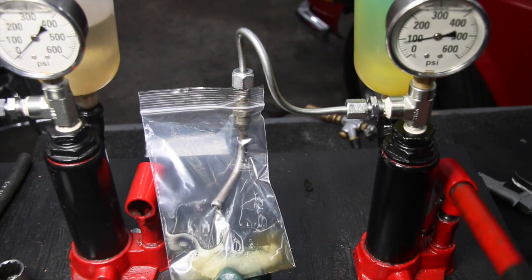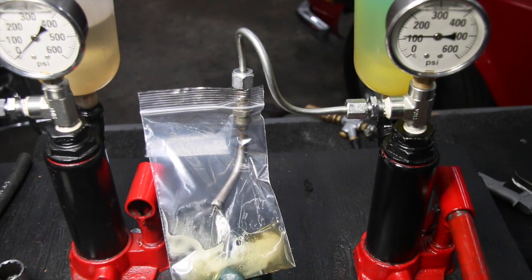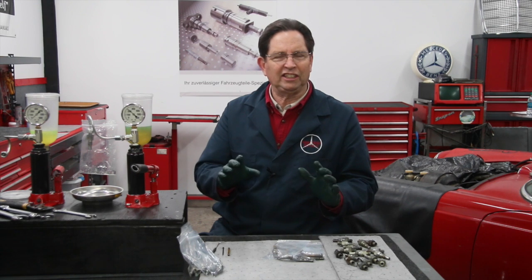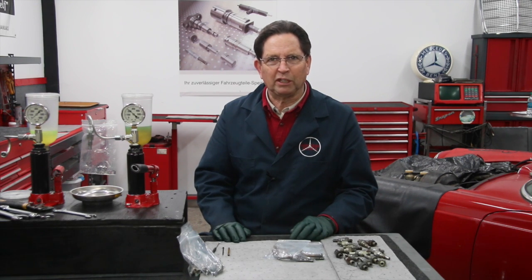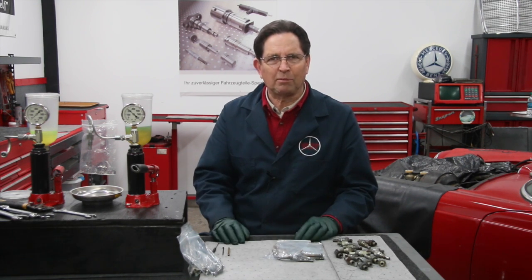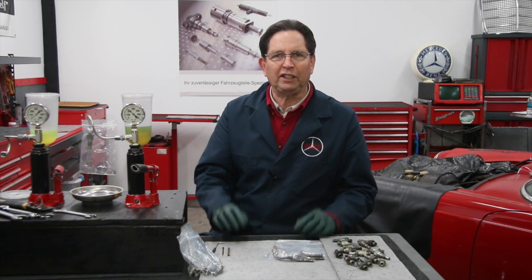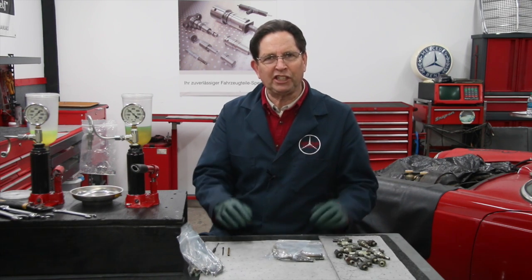Both of them hadn't run in a while, particularly the 6.3. But I find a lot of these old gas engines are running real rich. I've talked about this in a number of my videos, and also looking across the Internet at different forums and other videos, very seldom are the fuel injectors talked about. Everybody's talking about the cold start system and adjusting the mixture and the pump and all these things.